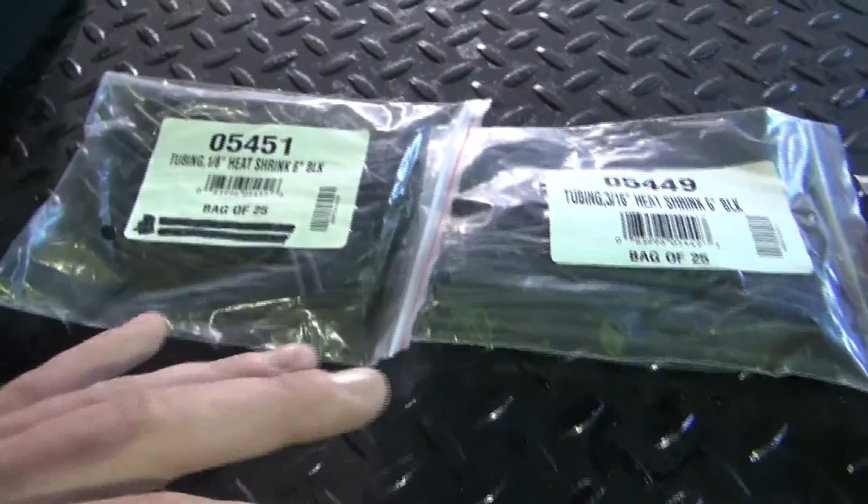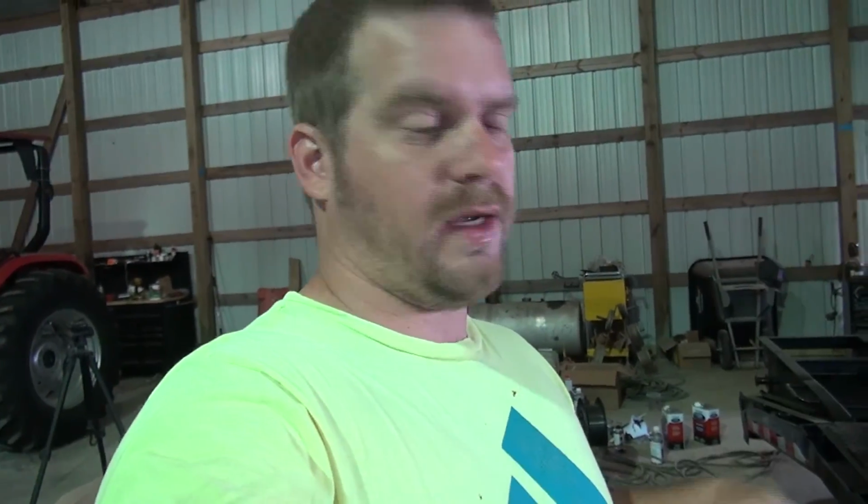But I would much rather have a soldered connection with electrical tape on it than any of these stupid wire taps, Scotch locks, all that stuff, because they corrode and they lose connection inside. And as far as I'm concerned, if it's soldered and you got tape on it, pretty good connection. If you got heat shrink on it, even better. But like I say, there's some situations you can't really get the heat shrink on there, depending on what you're working on, what you're working with.